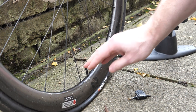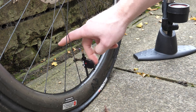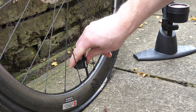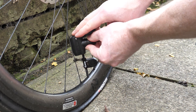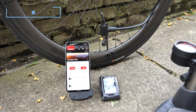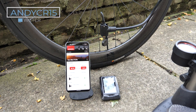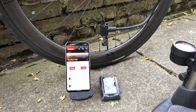Here I am taking the core out. I hadn't really thought about it, but let some pressure out first because it shot out at quite a velocity. Then I'm placing the sensor back in where the core was on the obviously fully deflated tire. I did find the stalk wasn't that long, so my track pump would almost wiggle its way off a little bit and you could hear air escaping.